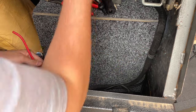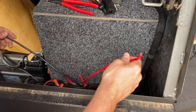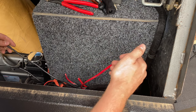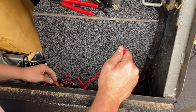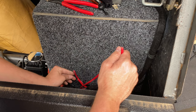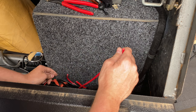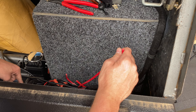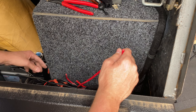So I've run the cabling down with that solar cable. What I've got is the BCDC output - that'll go to the batteries through a 40 amp inline fuse. I'll run the wiring up from the drawbar into this bit of twin here, so that's going to connect straight into the input of the BCDC. Then the earth will go double into this one.